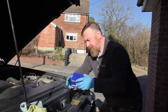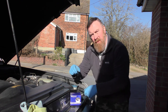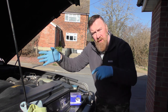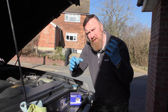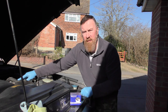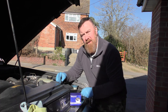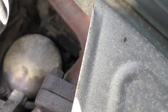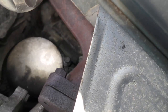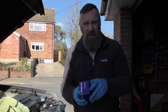This one in here — first time, nearly 10 mil. Now the nice thing what they did — the 10 mil two bolts that are in there only go up a certain way. I think they found that when people got them out, you were going to lose them down the engine. So they only go up halfway, then the cup comes off. We'll do that now. One screwdriver. As soon as you get this little filler cap, which is just in the way basically — pop it off and I'll show you what I'm going to be dealing with next. One 10 mil, another 10 mil — just do there, and that just undoes, and then out we pop that.